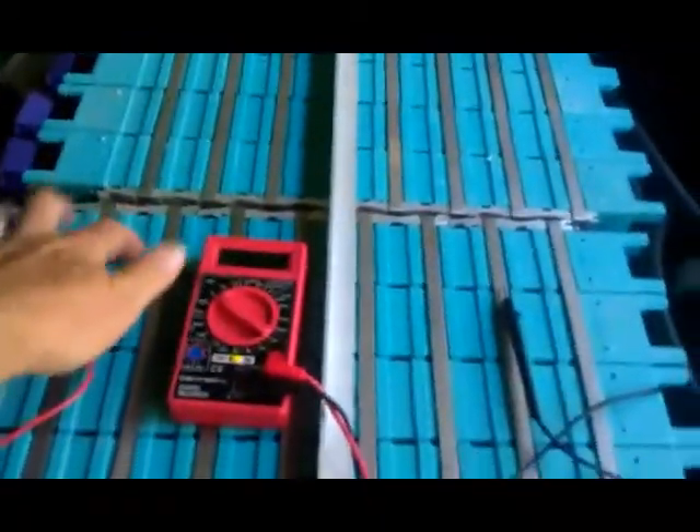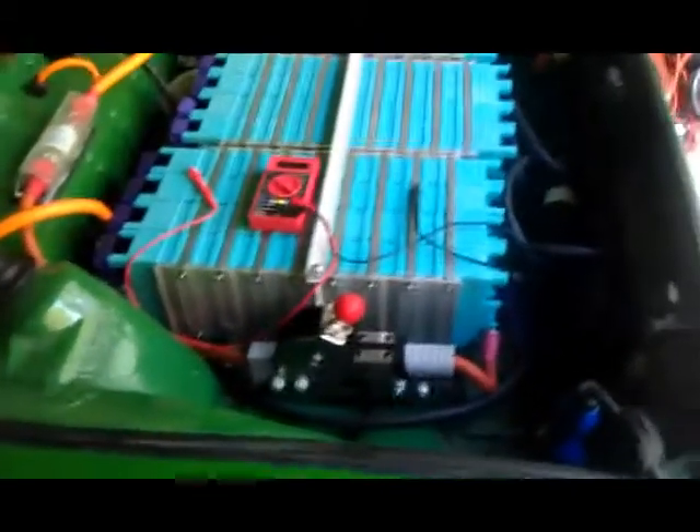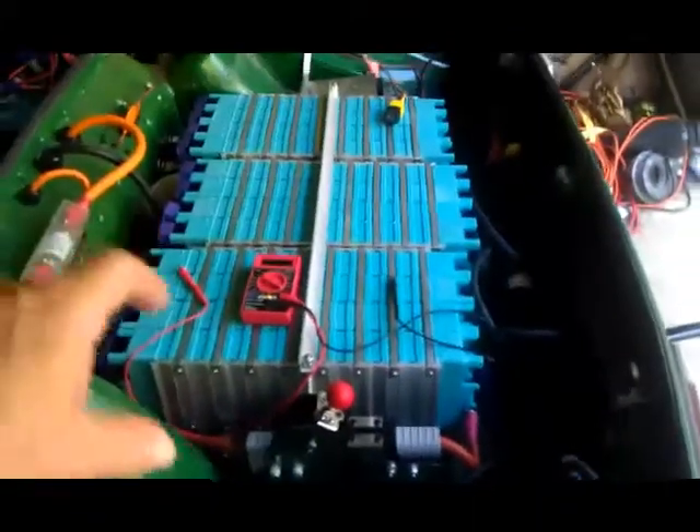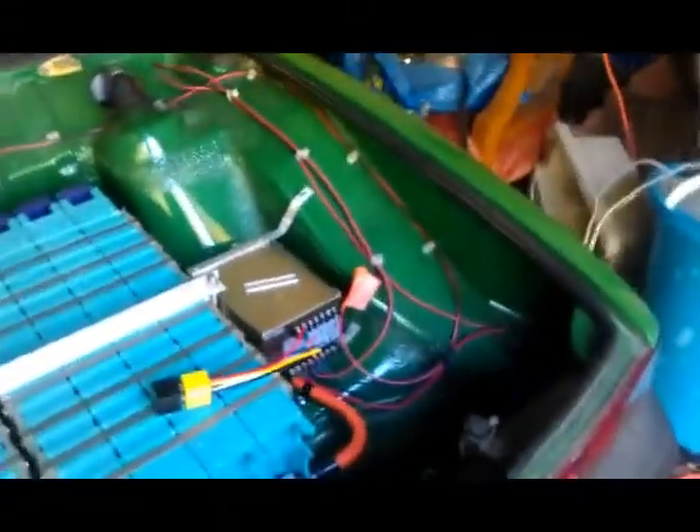I still have this little cigarette lighter adapter that goes into an AC adapter — I use it to power credit card machines at wine festivals. I'm pretty sure I can pull that damaged cell back from the brink of death, so it'll be fine for emergency backups at festivals. But you live and learn. I've potentially completely damaged one cell and totally fried my DC battery, and learned that the DC-to-DC converter is switchable — you can turn it on and off, and you should. Those are all lessons learned from my 914 project. Hopefully get those new A-arms in there, get the pack properly bottom balanced, and we should be good to go.